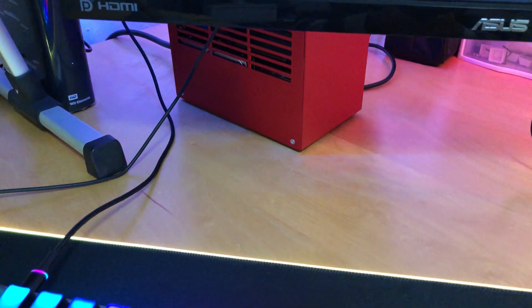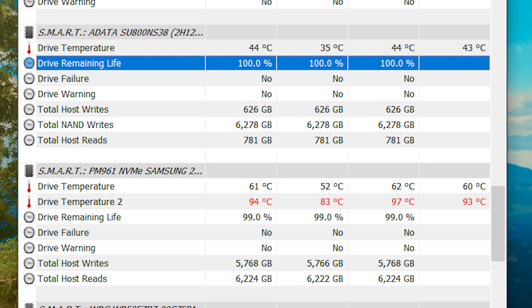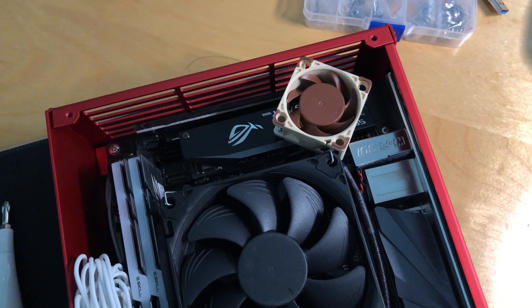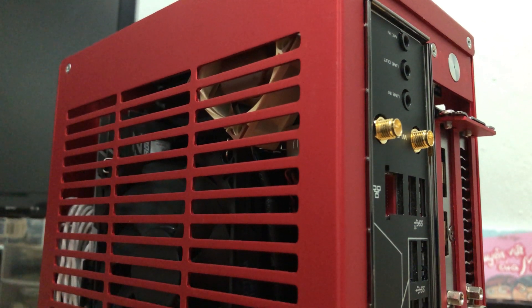Next, I want to see if I can benefit in the K39 build. The temperature for the M.2 SATA SU800 drive is pretty good at 44 degrees. But for the Samsung PM961 NVMe drive installed behind the motherboard, memory temperature is okay at 61 degrees, but the controller temperature gets annoyingly high at 94 degrees. I tried playing some CSGO and the game just crashed as it peaked higher than 100 degrees. So I want to see if lowering the temperature of the top drive can also cool down the bottom drive, like we just observed with the Intel board.